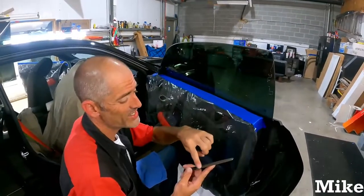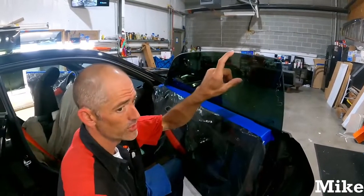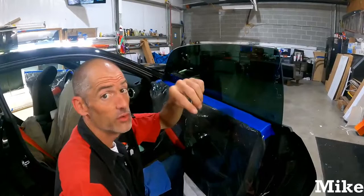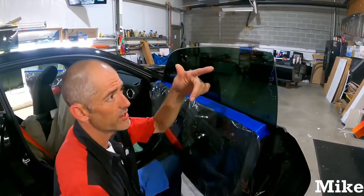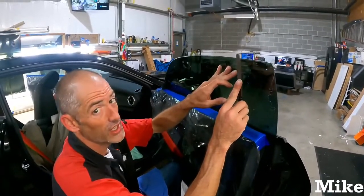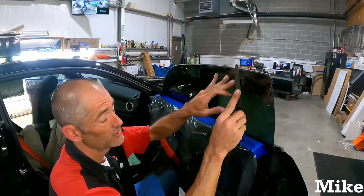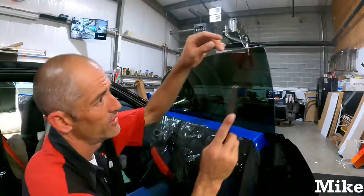These not beveled, once you get into here, the sharper ones, like I was saying, like the laminated ones, like Dodge Durangos and whatnot, Jeep Grand Cherokees have them. These real sharp ones can chunk that glass. Just round them off. Do yourselves a favor. Just round them off. It's something that we've found after years of experience.